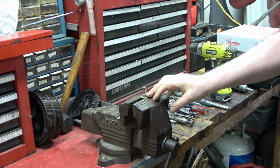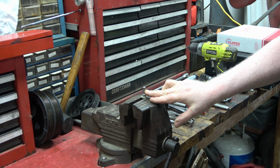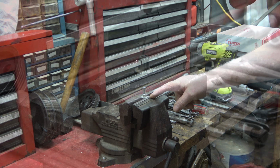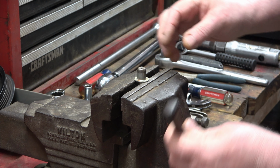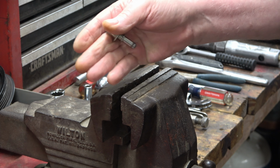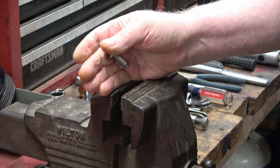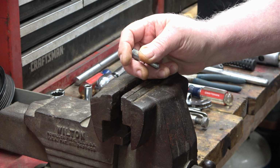So I'm doing some retrofitting on this PCV valve, drilling the top 7/64 and the bottom holes 5/64. I also drilled the 3 little holes in the valve cover gasket a little larger. I'm not going to go sizing here, just larger. Let this thing breathe a little bit. Keep the automotive police happy.